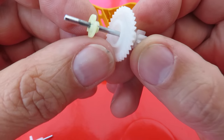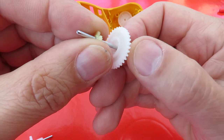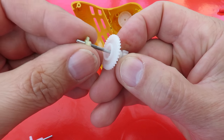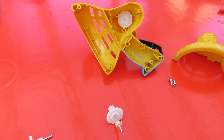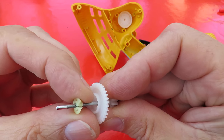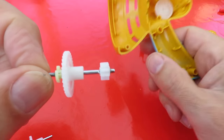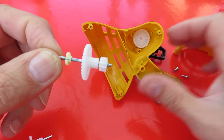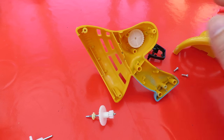That little ratchet is actually split — you can see that quite clearly. So it doesn't grip on the shaft anymore. I guess I could try and glue it — that might work. The postman's just been, so that'll be another Grandad's Postbag episode coming up shortly. So where were we? Yes, this is split, so I could try and mend it by putting some superglue on it, and that might work. We'll have our little ratchet effect working again — superglue it back together.